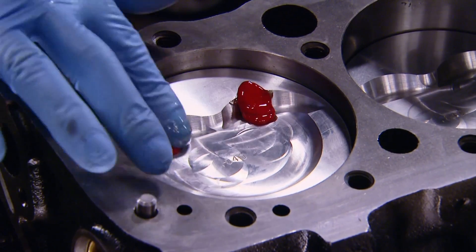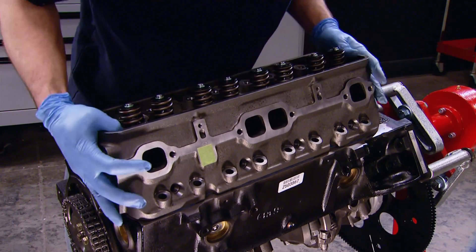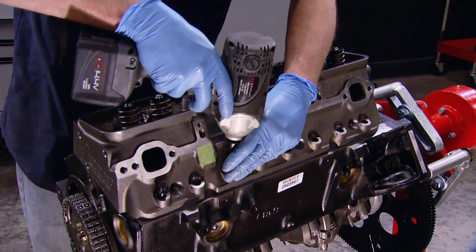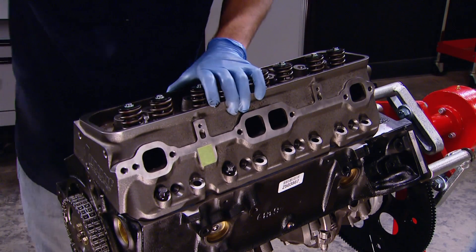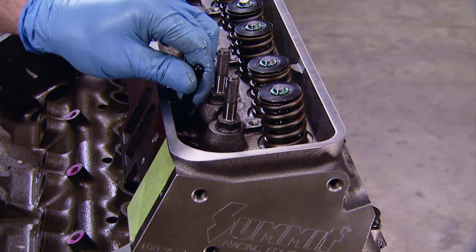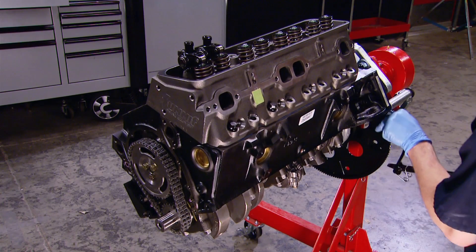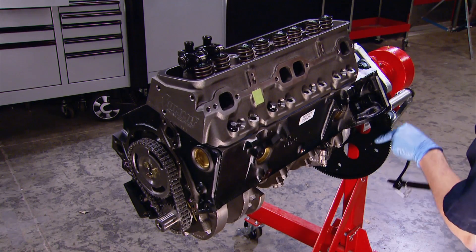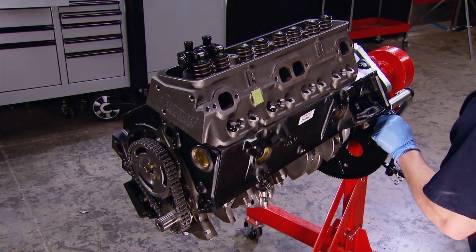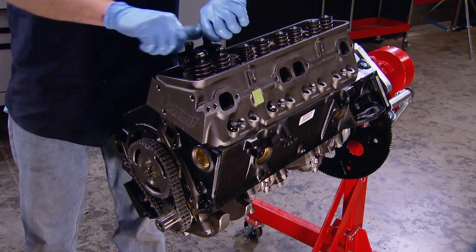Just a tiny bit of oil keeps the clay from sticking to the valves. You need to use the head gasket, but it will flatten out if you torque down the bolts. Most manufacturers will give you a compressed gasket thickness, and that difference needs to be taken into consideration — just snug the bolts to hold it in place; don't compress the gasket. In doing this procedure, you need to use solid lifters or some type that won't compress. Otherwise, the heavy valve springs will override and compress your hydraulic rollers, giving inaccurate results. In our case, we've temporarily modified the lifters so they won't compress. Another way is to swap out the heavy valve springs for some really light springs.